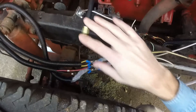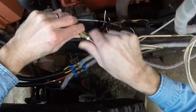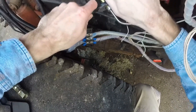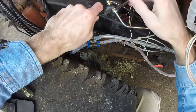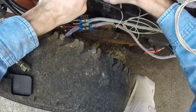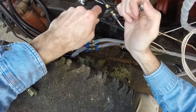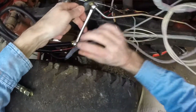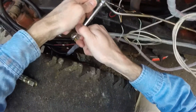Next thing is to hook this line up — I'm just feeding that in and tightening everything down. Unfortunately you have to use a regular 9/16ths on the flex line and a 7/16ths flare on the hard line. I'd like to use a flare on both but I just can't get it on there. That's in there good. We got it installed — that's what I wanted to get done today. I've got some kids to get up from naps, so I appreciate y'all watching. Make sure to hit the subscribe and like button — it's time for supper!